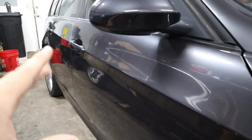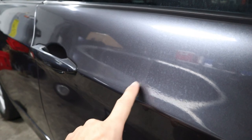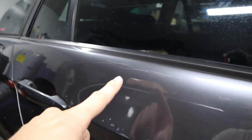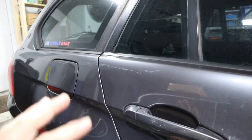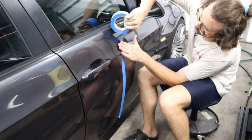The bigger things I'm worried about are some marks ingrained into the paint on the sides — I'd consider these water marks or acid rain marks. The car was probably stored outside for most of its life and not washed regularly, so we have this light ghosting of water marks. I can't get that out by rubbing it, but hopefully it'll come out when we polish, or at least become a lot less noticeable. And the scratches on the quarter panel with some focused polishing should come out all the way.